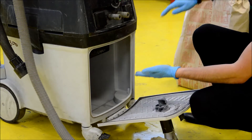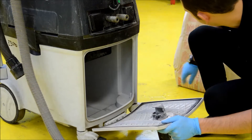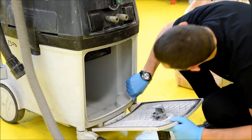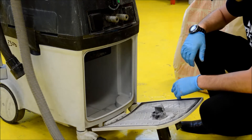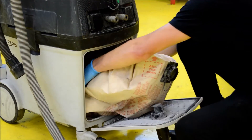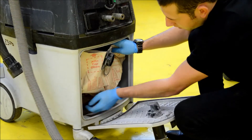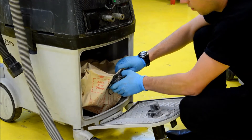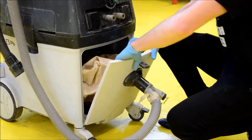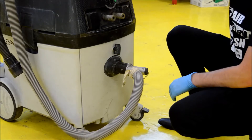As soon as we've taken that out, just give inside a good visual inspection - make sure there's no dust left inside because these bags do rip and it can fill the inside up full of dust. It looks okay. So we're going to put the bag back in because this one's not full yet, but when you put another bag in, obviously you'll put your empty one in, make sure the bag fits nice inside because we don't want it not sucking properly. Make sure it's pushed in properly so there are no leaks, make sure you don't trap the bag, close it up, lock it in a clockwise position and we're ready to go.